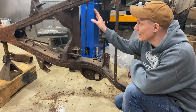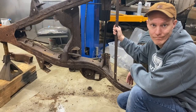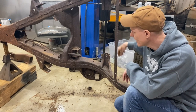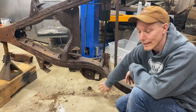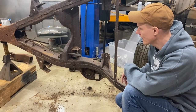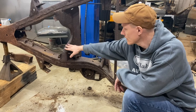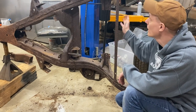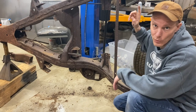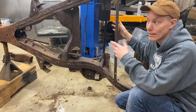Here's my game plan: I'm going to cut out this giant structural support thing here, cut off this shock mount, cut out this thingy here, and once those are all out of the way I'll be able to cut out the whole inner C channel that makes up the inside of the frame here, and I'll leave the outer part of the frame there. I'm not going to touch the outer section yet — I'm just going to replace the inner box tubing on this side. Once this side's done, I'll do the top side, replace all of the inner structure, then weld this back into place and weld the shock mounts back on or make new ones. I'm just going to do it one piece at a time until the whole back of the frame is new.